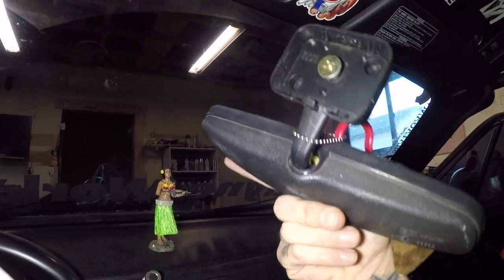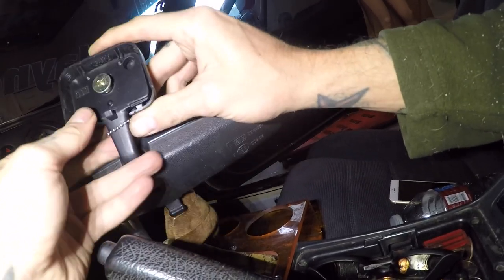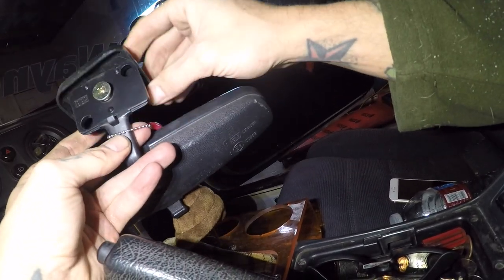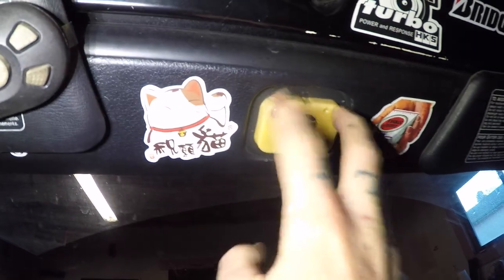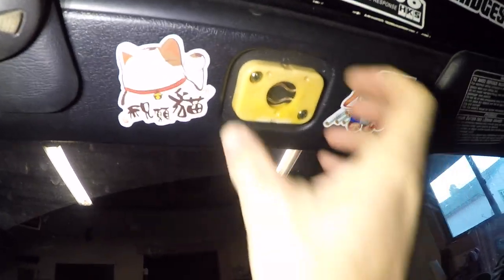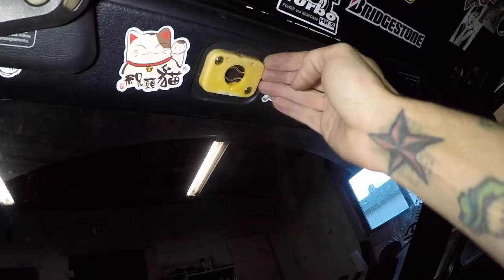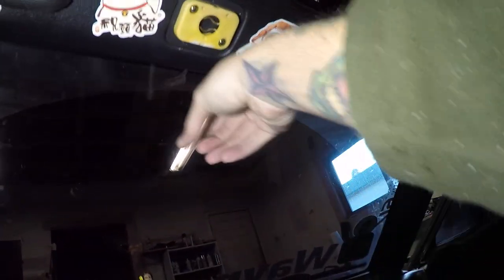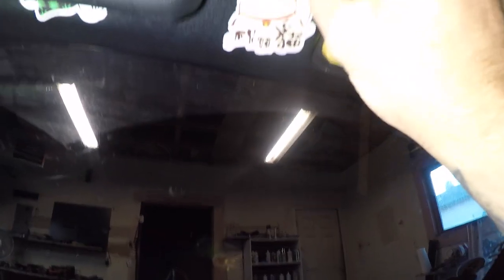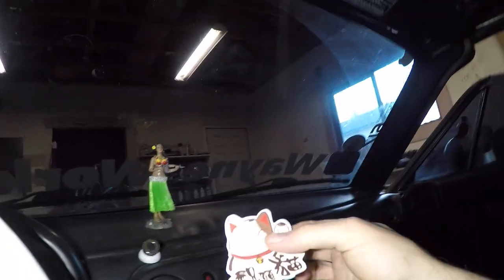If you pull gently on the mirror straight towards the back of the car it'll pop out of the grooves, and then you can remove this cover — pulling on the front tabs will release the hooks and it can flip up and out. It's got a couple of Phillips heads that hold the bracket. The bracket just needs to be put on top of the metal piece I'm placing here, so I need to accommodate for that when I make the angled-down pieces. It's basically a box on a box — switches on one side, switches on the other, and the mirror still coming right out of the middle.